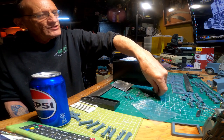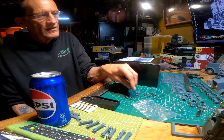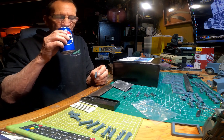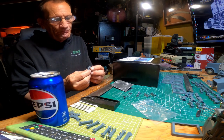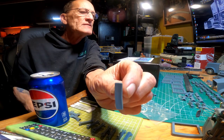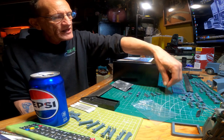Okay, that is in case you want to bypass the DPF system and put a standard battery box on that side. Which, you know, for many deleted 389s and things of that nature, is pretty common out there. But if you are using the DPF box and the DPF filter, you will need this smaller, narrow one because it takes up more room on the passenger side.